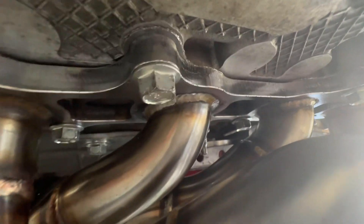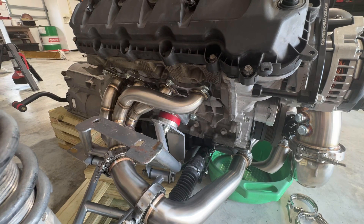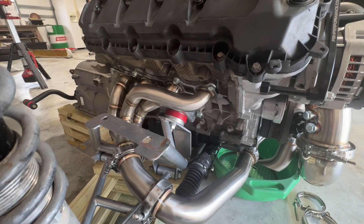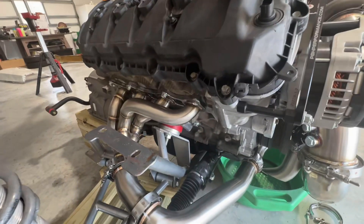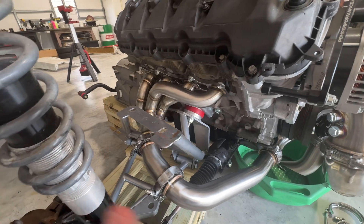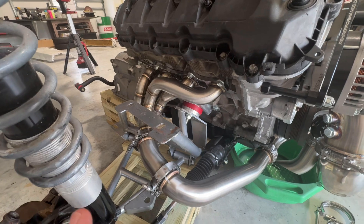We're using a factory style exhaust manifold gasket instead of the graphite or whatever comes in the kit — I've had better luck this way. Main thing: bolt your headers up. You can crank them down as much as you want, get them as tight as you want, because those are not going to move.